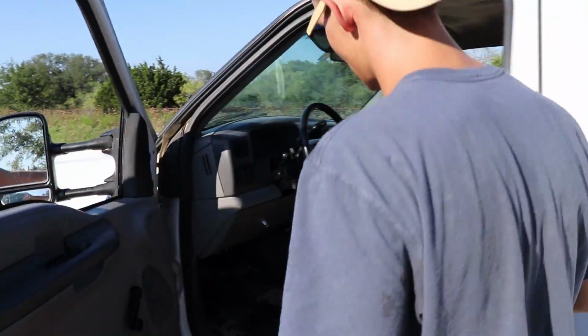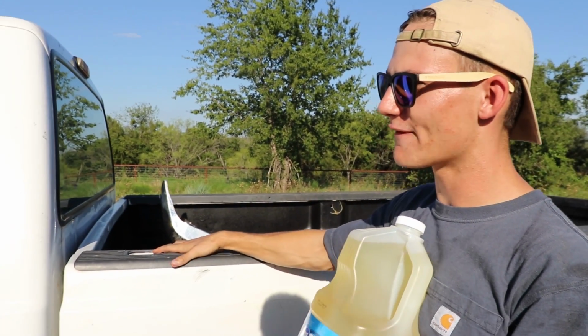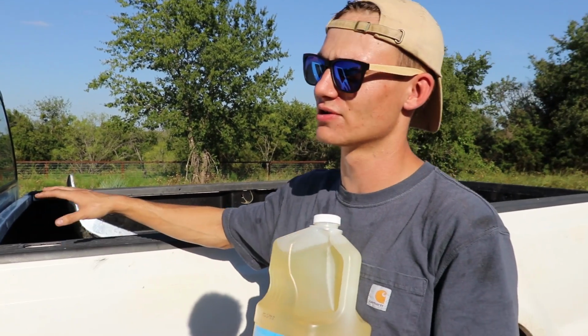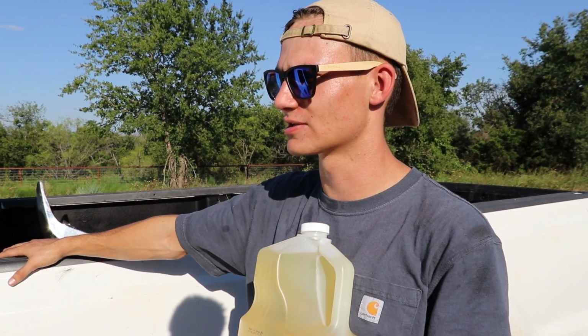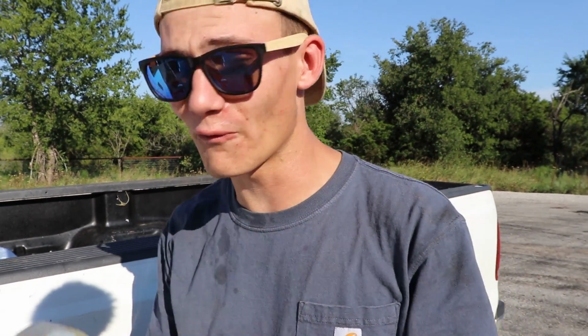Now, for this first test, we're gonna have probably like a 70-30 mix, 70% vegetable oil and 30% diesel. And the main thing is, guys, we're using a truck. Not very many people have done this. In fact, I don't think there's any videos on YouTube where someone's used a turbo diesel fuel injected setup. This stuff is very easy to clog your injectors with. So hopefully that doesn't happen today.